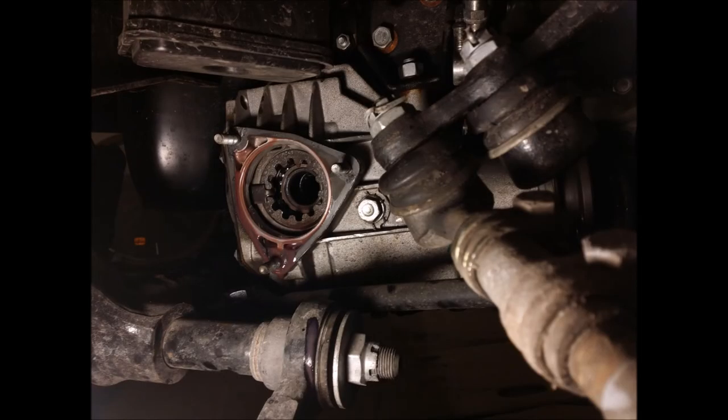This is the point that was really disappointing. I damaged one of the gaskets while pulling the hub back and forth — the axle stabbed and gouged it out. The other gasket tore in half, one piece stuck to the differential and the other to the axle. Again, you should have spare gaskets on hand. I used Permatex to put the car back together — Permatex is used in production these days so maybe it's not an issue, but it would have been much better to have the proper gaskets.